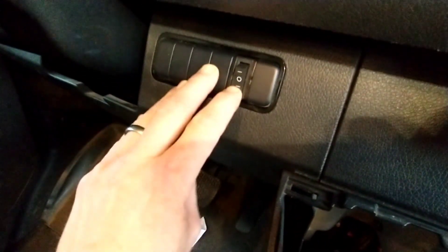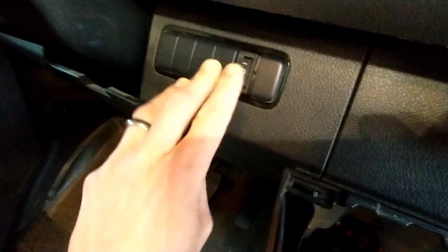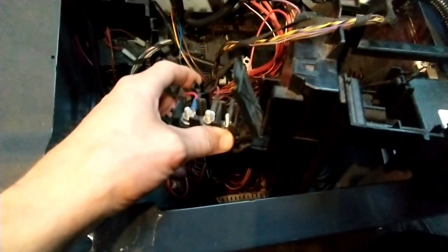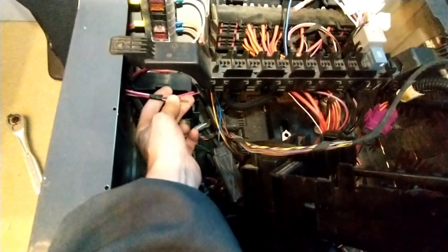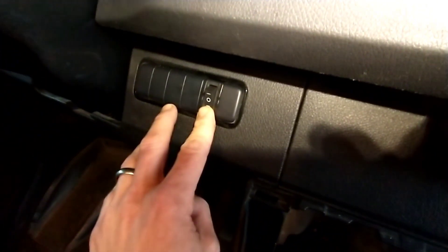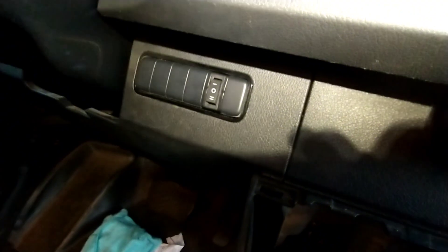I've got 3 wires run up into the dash, and I've got a single-pole double-throw switch. The Renogy allows you to do a half-current option, so I can pick 30 amps or 60 amps. To do that with 3 wires, I've got one wire that'll be coming from right here — which is engine running — which is good to have on a Mercedes, so it's not just ignition on; it's actually once the engine starts running and the alternator's putting out power. These wires go up to the dash — van-on going out on the red, and then the gray and brown are the two wires coming back. I've put a diode between both of the outboard contacts — the gray and the brown — so that when I'm in the 60-amp position it'll be providing power to one wire, and when I'm in the 30-amp position it'll be providing power to both wires, because that's the way the Renogy wants it — two 12-volt wires.